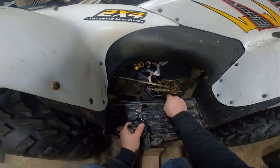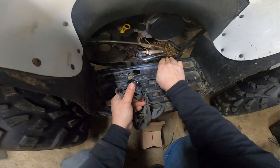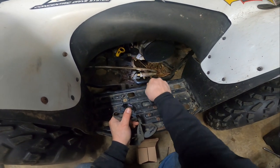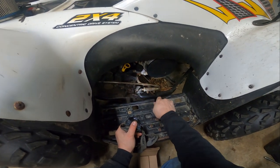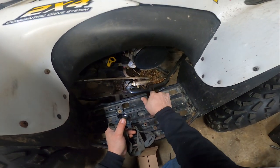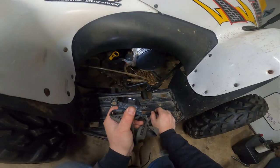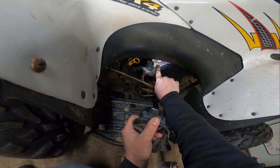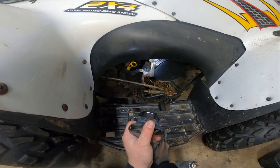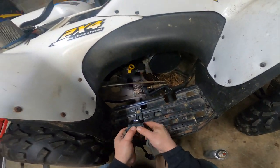any resistance. So these plungers, oh, you can see it. There's water coming out that plunger. Gasket shot on that caliper or that little piston. You can see the water kind of bubbling out in the bottom of it. We'll talk to him about that one. And it's interesting. I don't know. That one's been replaced already once before. It says Robin Manufacturing on the top of it, but.